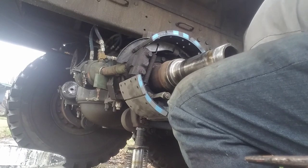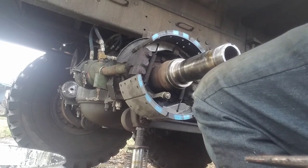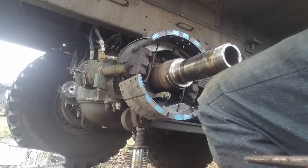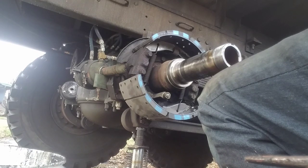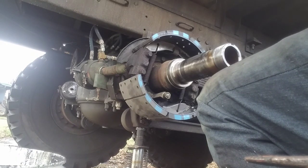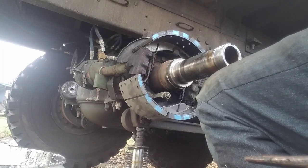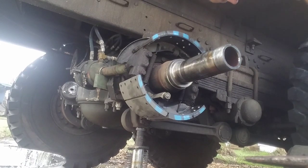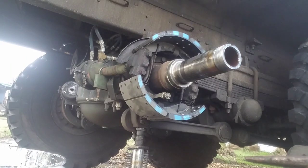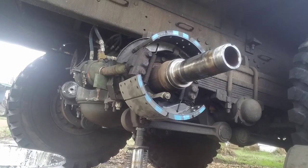I'm gonna go ahead and put the drum back on — this is the worst part of the whole job. I'm not replacing the rear seal on mine. Rear seals in these things are pretty much junk anymore aftermarket-wise. If you have to take one out, get a long crowbar, set the drum hub-side up, put your crowbar in there and put your foot inside the drum — basically just keep slamming the crowbar against the outer drum and it will pop the seal out, about 10 hits and it comes right out. Make sure your drum is cleaned out — you may have some grease and oil in there from sitting it down.